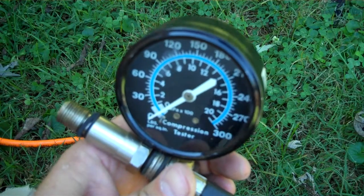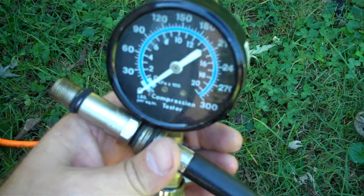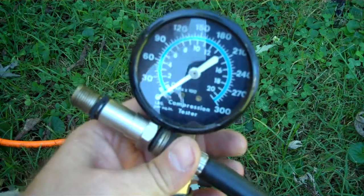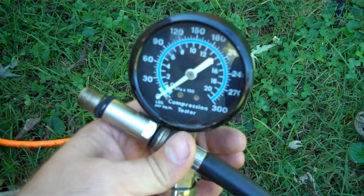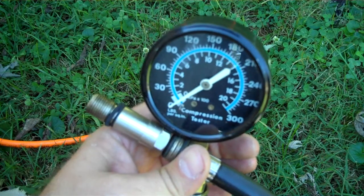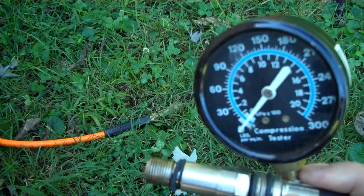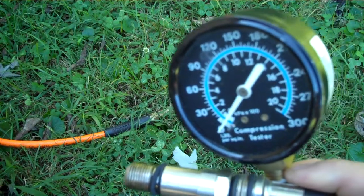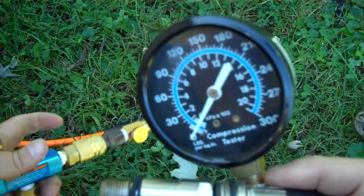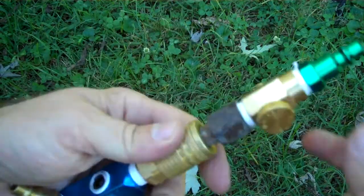The reason for this video isn't just to show you a compression test or give you a quick how-it-works. I need a leak-down tester. That's another tool I don't want to go buy. There is a quick DIY way to do it — it works. It may not be as accurate as some of the high-dollar versions, but it works. So what have I done? Good question — look at this little adapter here.